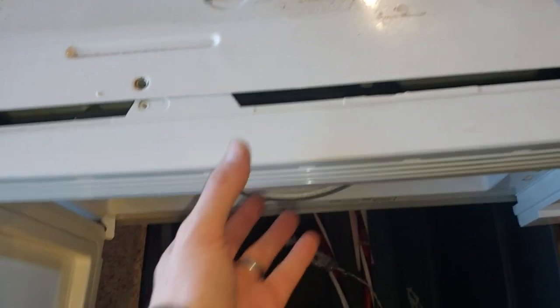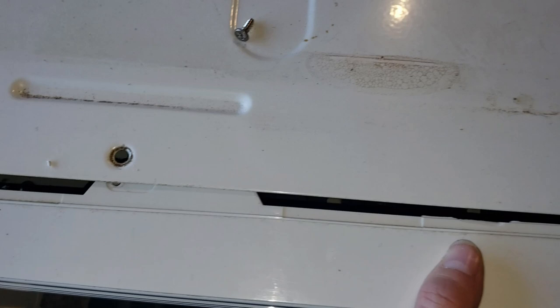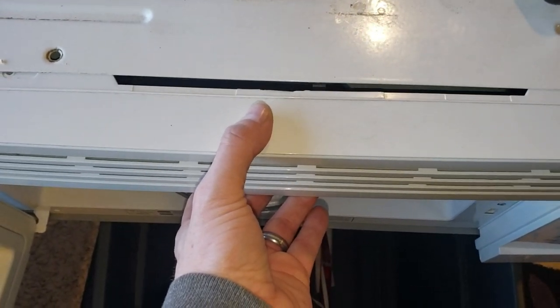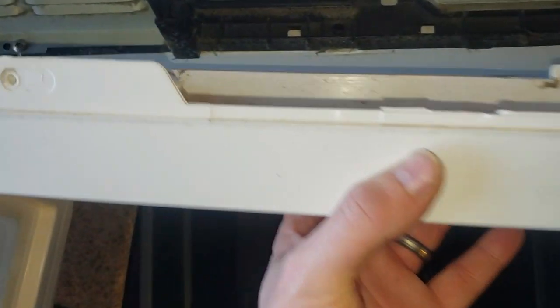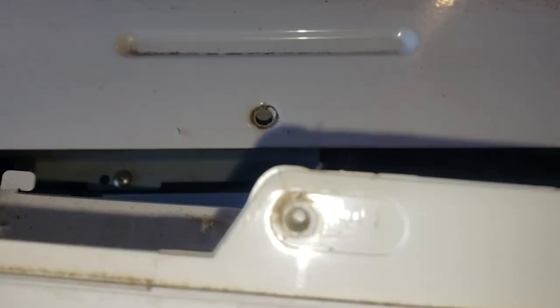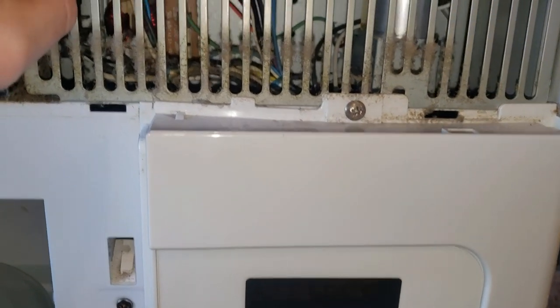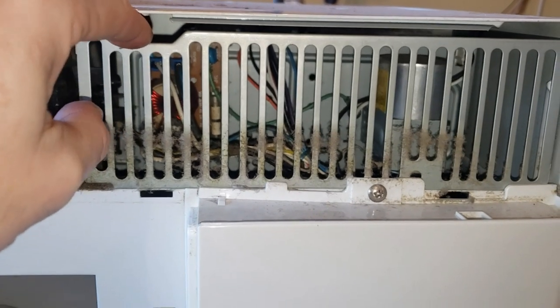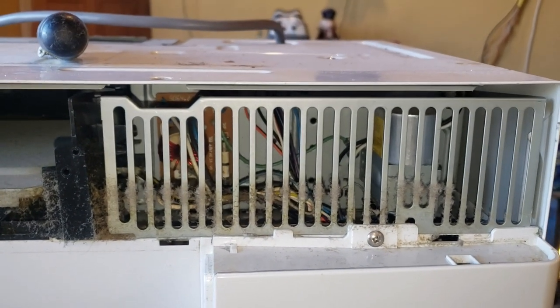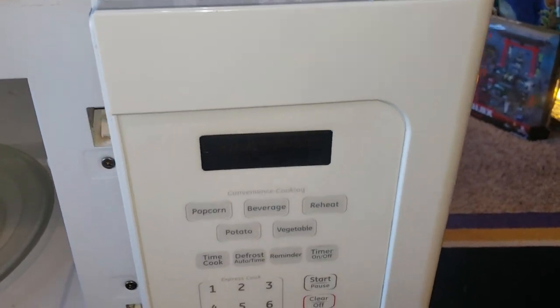To help understand the removal so you don't break any tabs: after you take the two screws out, slide the whole unit to the left with the door open, and the bottom and top will slide out. There are clips at the bottom, so it has to go left to get out of those notches. Then remove this piece — there's a screw here to remove, and the little wire grill section will also come out. Then the whole keypad just lifts up and you can pull it out.